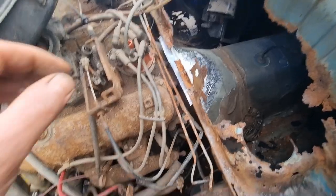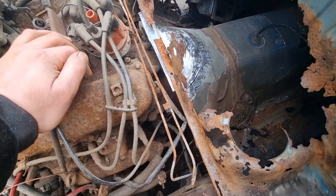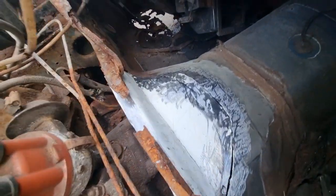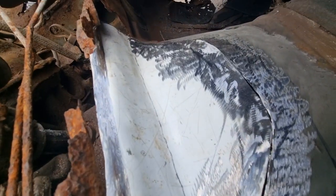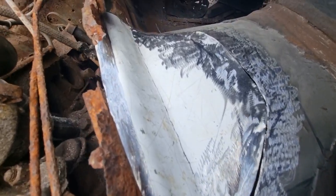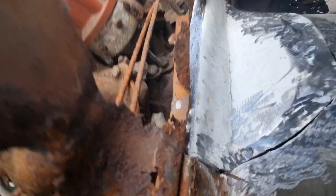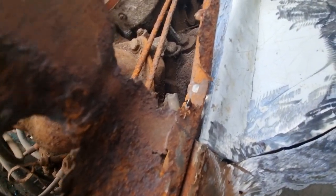Just wanted to show you where I'm at now. I've started grinding all the metal clean ready for the weld. I've just test fitted it - it's pretty spot on, perfect shape all the way around. I think I managed to make that panel perfectly. Obviously there's bits and bobs that need to be knocked in, but there's a join right in the corner here so at least the bottom bulkhead will be repaired.